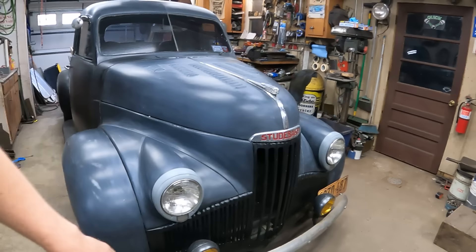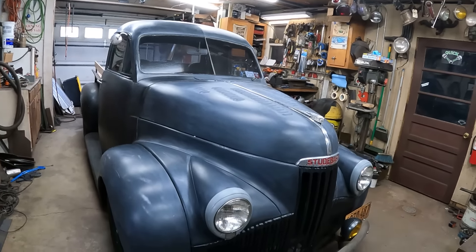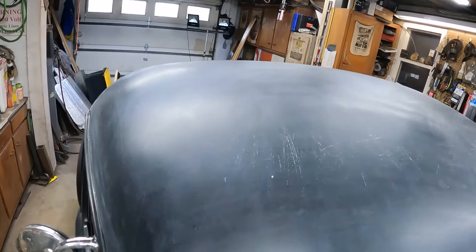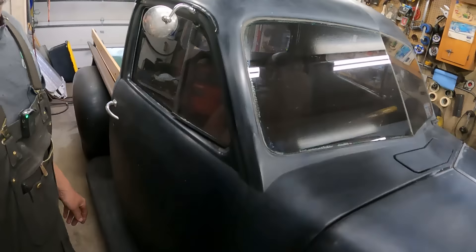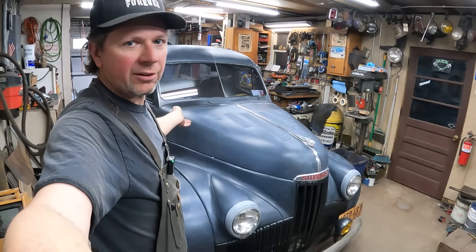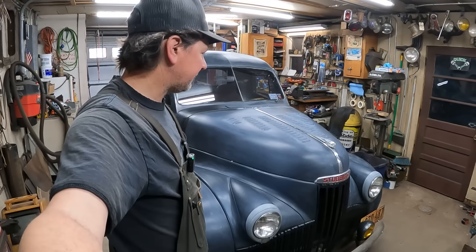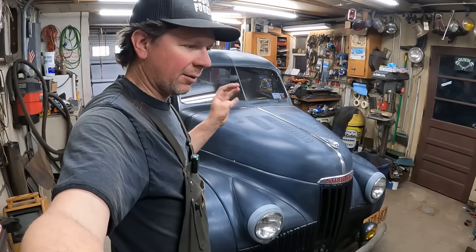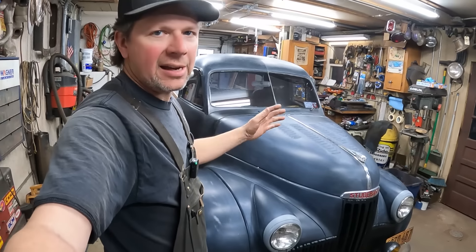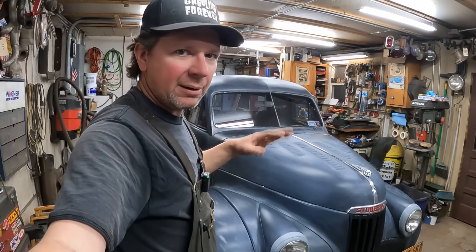You're not going to need that much — probably a coat and a half, two coats, just to make it black. Paint it black, hit the track. There's something goofy going on with the paint on the roof — it's all cracked and coming apart. This whole truck was epoxy primered almost 30 years ago, then driven in the sun for many years in epoxy primer, which made it really hard. I sanded it and painted it; it somewhat flaked off. It basically needs to be DA'd down to bare metal, bodywork finished, re-sealed, and painted the right way. But for now it's just got to be painted black.